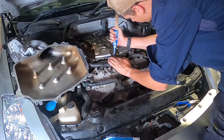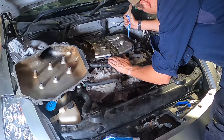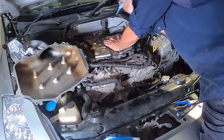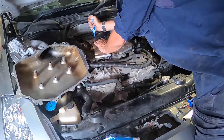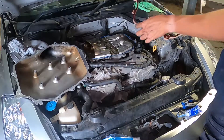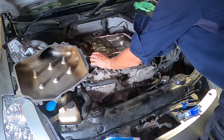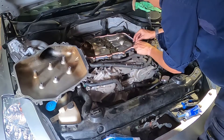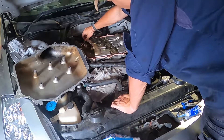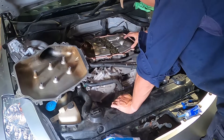Now we're just going to lay down some blue gasket maker. If you've ever worked with this stuff you can probably already smell it through your screen. We're making our way around the bottom side of the plenum — I left the factory gasket on there and just laid the gasket maker on top of it. Just made a little bead all the way around, gave it a couple of minutes to set and get a little bit firm, and then put the plenum spacer on top and pressed down lightly. You're not trying to squeeze all the gasket maker out the sides — you want to leave a bit in there but make sure it's got a good contact surface all the way around.